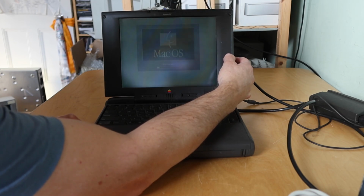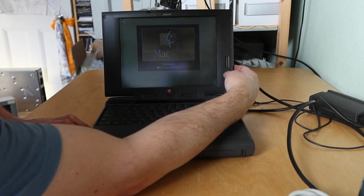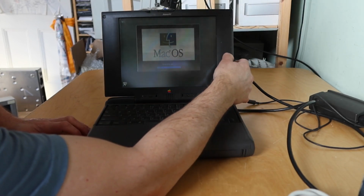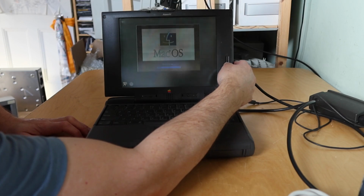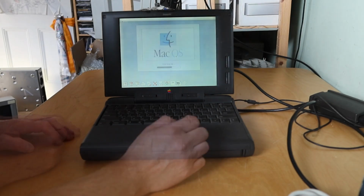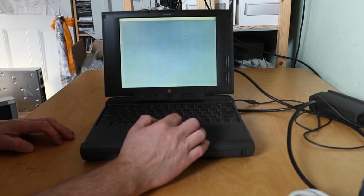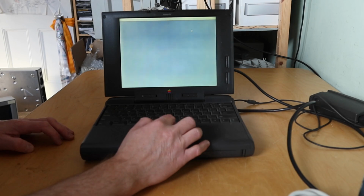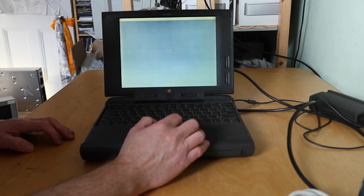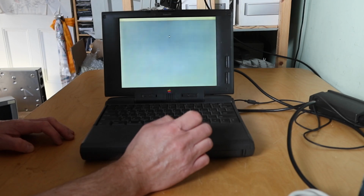A little play with the brightness. And contrast. The contrast has made a bit of a difference. Adjusting the brightness had no effect at all. Okay, actually it's starting to look reasonable. So it's a colour display, but the colour is very washed out, and when I move the mouse it submarines, so presumably this is a DSTN non-active matrix screen. There's quite a lot of flicker on the camera as well, which isn't present in real life. That's probably fixable.